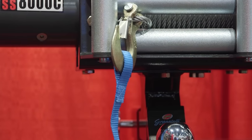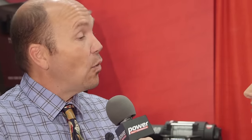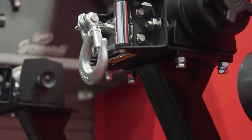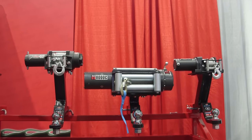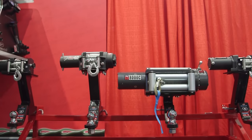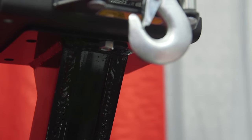So you can position the winch anywhere between four and 12 inches above the trailer ball. That covers two things: it allows you to accommodate a big trailer or a little trailer, and more importantly it gets the winch as high as it needs to be to winch your car onto the trailer. For a really low car, you want the cable as low as possible so you don't take the nose off. But for a side-by-side like a Rhino, where the pickup point is much higher, you'd need that extension — so we have the 12-inch riser specifically for that.